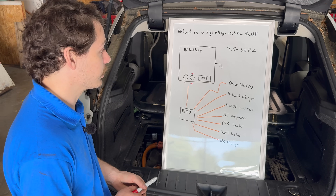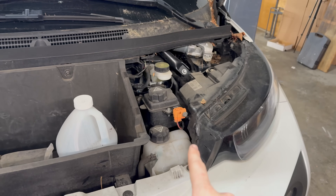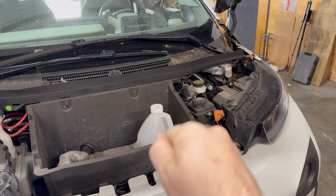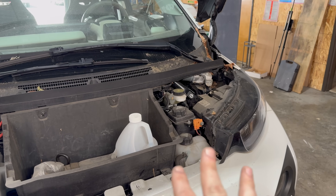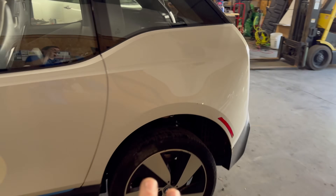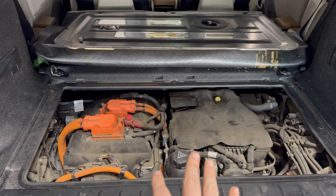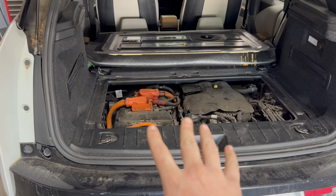Let's take a look at this i3 and see what we've got going on. The first step as always with any car is to make sure your high voltage system is disabled — you always want to disconnect the 12-volt battery and disconnect your high voltage interlock. On the i3, it's this little connector right here; it unplugs and you can basically stick a bolt in it to lock it out so someone can't plug it back in. Every car is going to be different; some have a big physical disconnect that pulls out of the battery, some just have an interlock that unplugs — it's highly variable, so do your research.